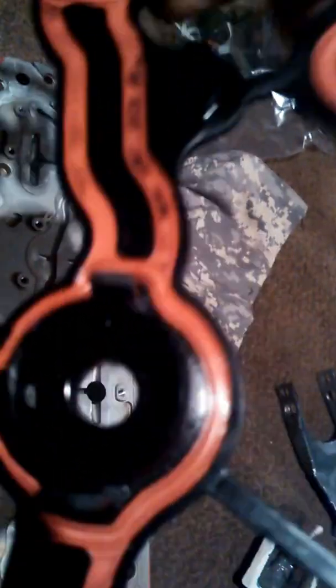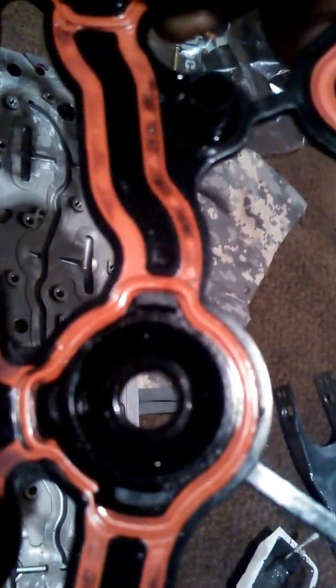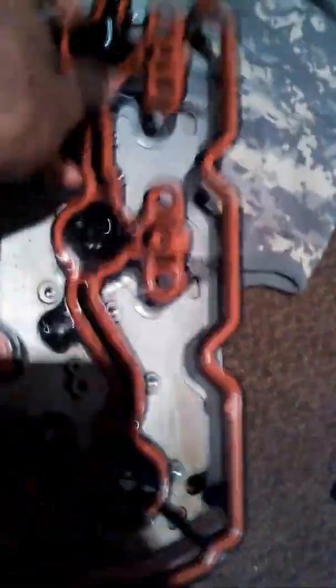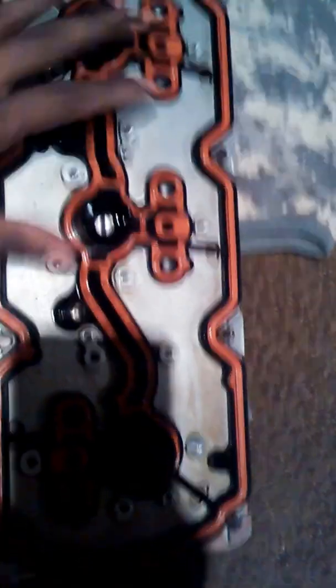Second failure point. Each of your solenoid things have another mesh screen installed right here for the nozzle, on both sides. It's inside right there where the solenoid locks into — you can see light through it. That then installs on top, like so, of each one. You can kind of see how that works.